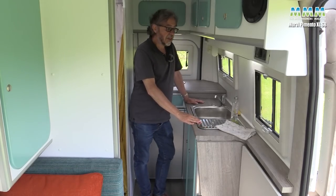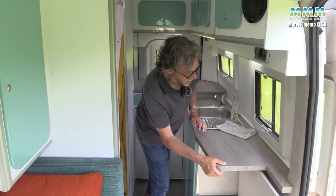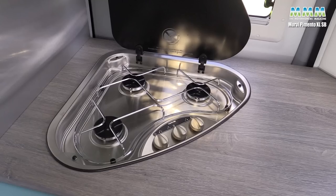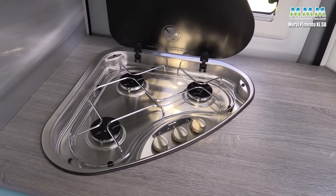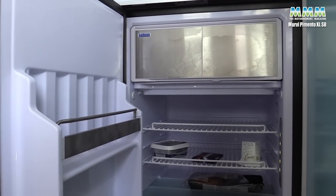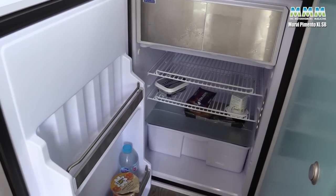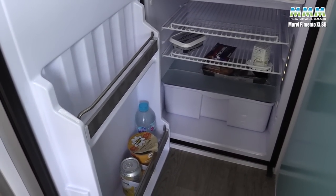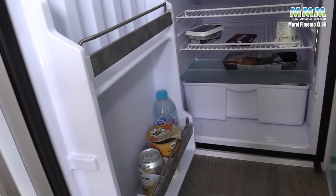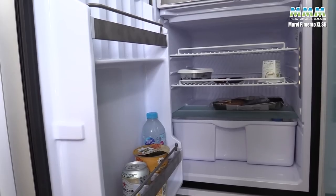Another star feature is the kitchen area. You've got plenty of worktop even before deploying the extra flap at the end, which really puts most coach builds to shame. You get a three-burner hob as standard, and a choice of kitchen fittings depending on your priorities. This van has a 115 litre Isotherm compressor-type fridge. Alternatively you can have a 93 litre three-way automatic energy selection fridge running off gas, mains, or 12 volt electric. Compressor fridges are more tilt-tolerant, get down to temperature quicker - I tend to prefer a compressor fridge in a campervan, but you have the choice.